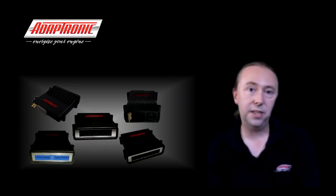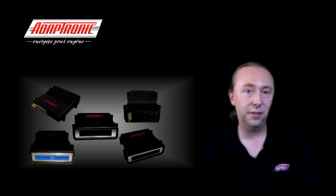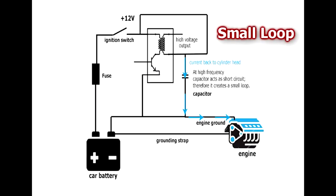On old-style ignition coils with just two pins on the primary, the positive pin connects to the other side of the ignition coil. So we need a current path from the cylinder head up to the positive pin of the coil. Without understanding this, the current path would go from the ignition coil positive back through the ignition switch and fuses to the battery, then from the battery negative back to the engine through the grounding strap — obviously a very large loop. What's normally done is connect a capacitor between the positive of the ignition coil and ground on the engine. Think of a capacitor as a short circuit for high frequencies and an open circuit for low frequencies — so high-frequency ignition noise goes straight through the capacitor, and that becomes the new current path.